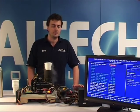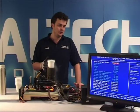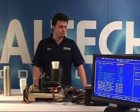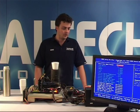Usually CPUs in 45 nanometer will cold bug anywhere between minus 60 and minus 160. That's the range they can normally handle, not the full minus 196. Most CPUs I've had will probably reach about minus 110. So hopefully if we can get to minus 110, it will help us get the overclocking results we need.